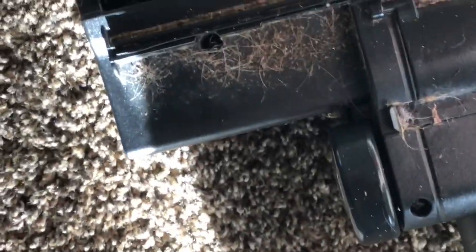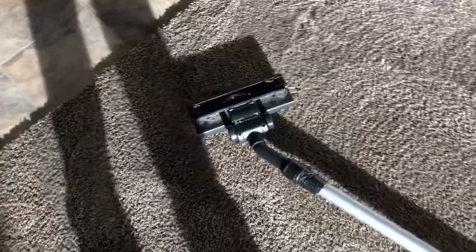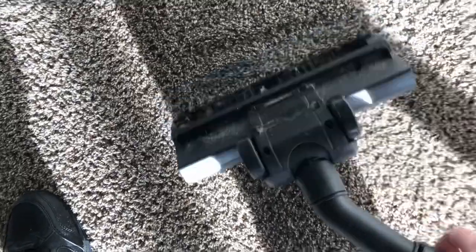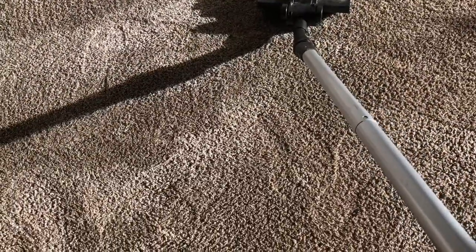I can tell you where I got that on Amazon — I need to clean it off. It's been a while since I fired it up, and I was going to show you the brush roller and how fast it spins. Unfortunately, I think there was a clog, so I'll get that fixed right after this. Yeah, it's barely spinning. There's a little cap I couldn't get off, but there's a turbine in there — the roller is driven by the suction. The little turbine creates rotation. I think either there's hair wrapped around it, but I'll get it fixed and show you. This thing is incredible.